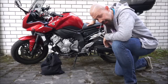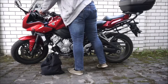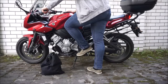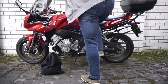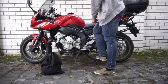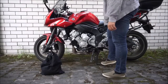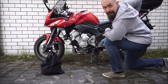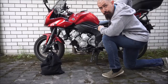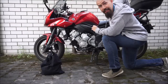Okay, so first thing we want to do of course is to put the bike on the center stand. Unlocking the front wheel, making sure that the bike is in neutral, putting it down on the center stand, tilting it just a little bit until I feel the second part of the stand catch on the other side. Then I'm putting my entire weight on this lever here, and my hand on the passenger hand rest, pulling slightly up — pulling only with my hand, not with my back. The idea is you only use your weight and a little bit of muscle power; definitely never use your back to do this.